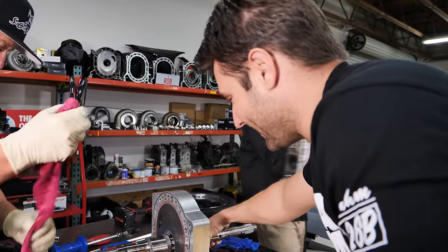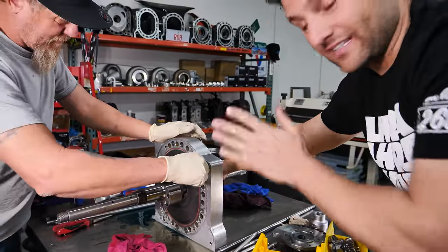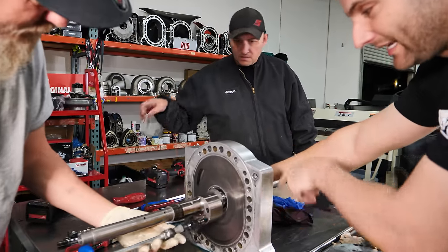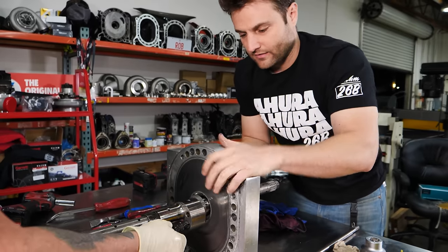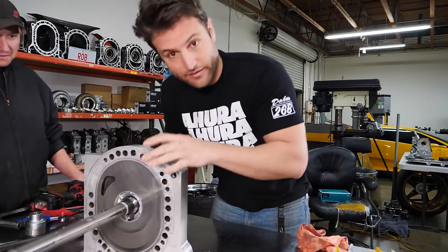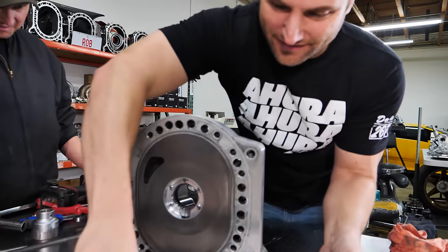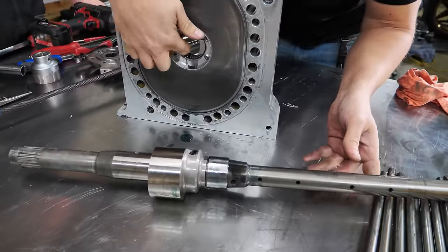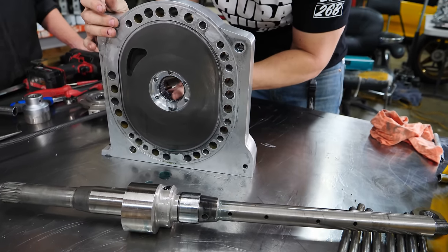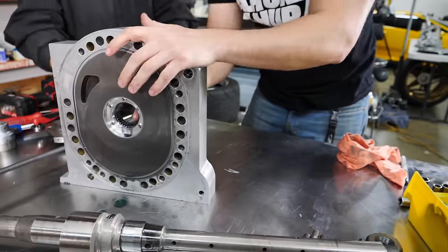It's probably escaping through there. She did a good job again — we found a ton of power. Here is the true secret sauce: this is the core of this motor, and the results are proving it. We believe this makes it superior to most — if not all — four-rotor engines. This lobe is not connected like on a miniature two-rotor — normally the two lobes are connected from raw material, but this lobe is removable. And that right there — that's what I blurred out in the previous video — is the race for a center bearing. So the very center of the engine is also ball-bearing supported. With all the oil pump failures we've had, this thing has earned its fair share of credit. Journal bearings are perfect for everything else, but this is just one more level of holding the engine together.